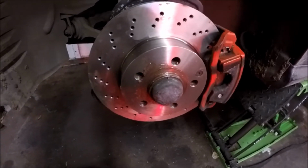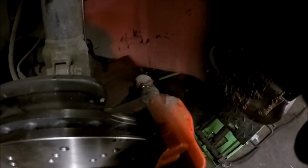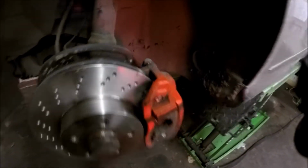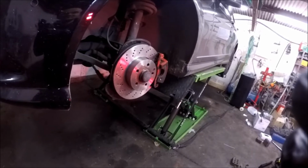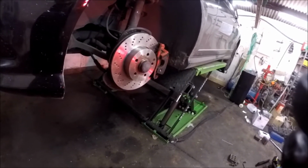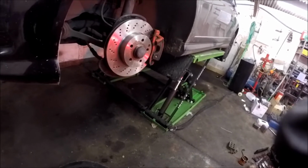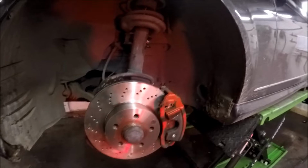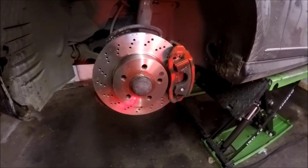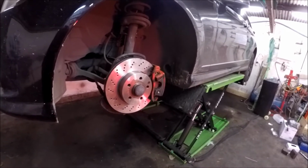We're just going to pull some brake fluid out the top of the pot. Because it's 9 o'clock at night, and if I start trying to move them bleed nipples, they'll end up snapping in them calipers, because they've probably not been touched since new, or it's been at Merc for its servicing, if they even change brake fluid. Because I know they call the ABS system SBC, something like that, that it's a service requirement that all the brakes get done at a certain mileage. It might be over 150k or something. ABS pump, calipers, the full thing gets replaced. So I'm not even going to attempt to move them bleed nipples. I'm just going to pull some fluid out of the pots, and that'll just mix with the fluid in the lines, is what I'm going with, because it's 9 o'clock at night and something will end up breaking on me.